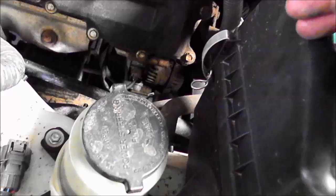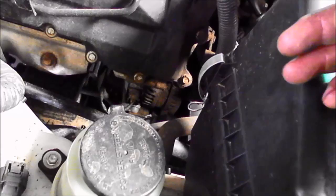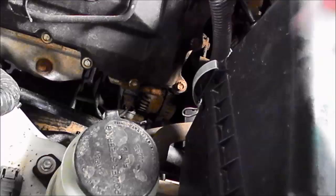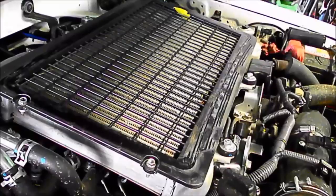On the diesel, another thing I forgot to mention — on the diesel fuel line there should be a little drain plug for water or condensation. You can just let that out if there's any water in there. On this one we're not doing a full service, we're just doing a minor service so fuel filters we're not going to worry about.